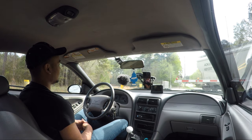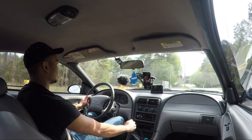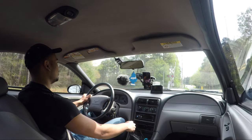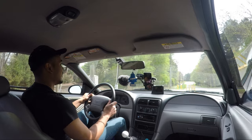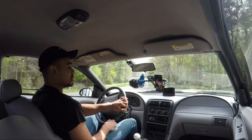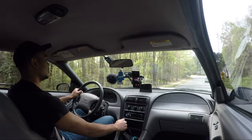That's pretty much it with the two-valve. I think I really want to do boost on the two-valve. I was thinking about cams, but the three-valve would be better for cams because of ease of install. The two-valve would be better for boost because even with cams the two-valve will only make around 300 wheel horsepower.